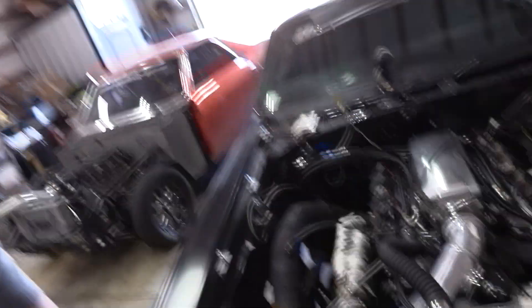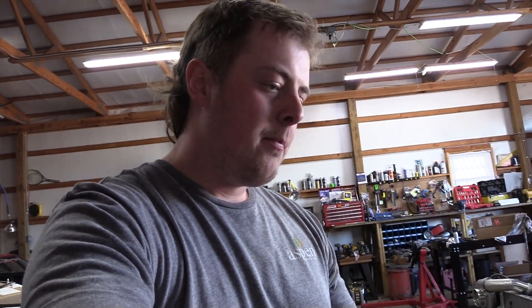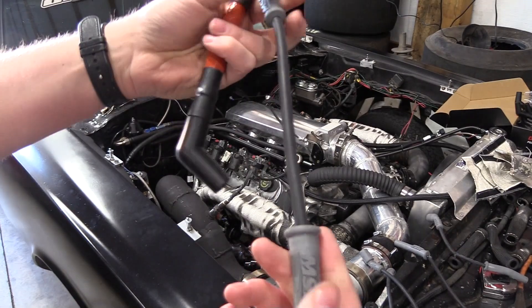I think the reason was these are kind of straight — multi-angle, any-angle or whatever — and with these headers you just can't do it like that. So I got some new plug wires, they're 45-degree angle. I'm going to put those on, put heat protector on all of them, and then go pick up Matt and we're going to drive this thing and see if it's popping, if it's running better, if it's getting on the brake.